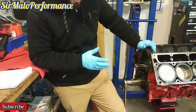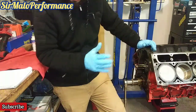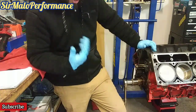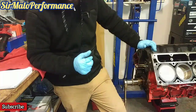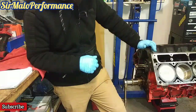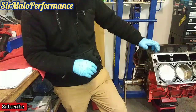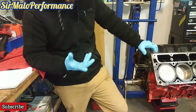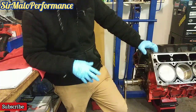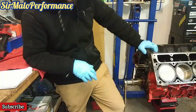I think on an LS, if you have a 110 to 116 LSA, you keep a nice broad torque range and you get a nice slope to it. I'm more of a 114, 116 LSA kind of guy, and that's what this is. This is a 114 LSA. So, little cam specs here and there. I kind of pick and choose them, and that's what I requested. Maybe there's a cam out there already with those specifications. I honestly haven't looked, nor do I want to look, because each cam is like $400 out there. So I might as well get my own cam going.